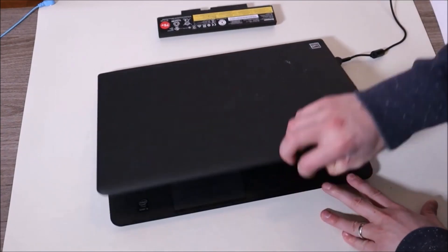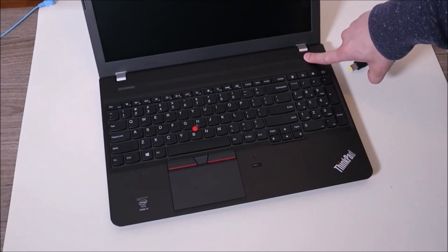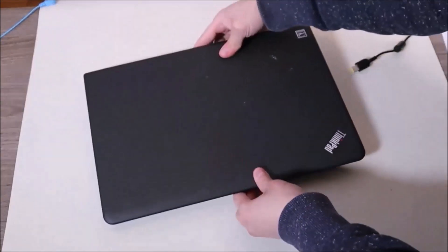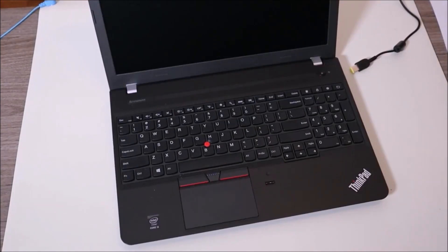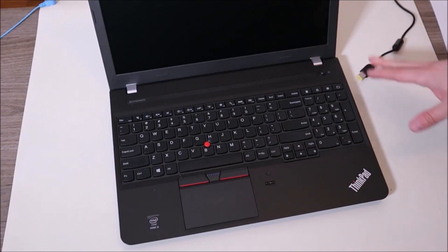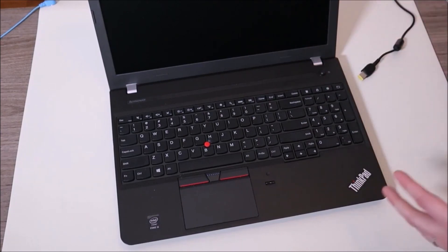If that doesn't help your computer turn on, unplug your charger, press and hold the power button for another minute, and now put your battery back in but leave the charger out — kind of swap them and try the other one. Try turning your computer on. If your computer turns on, you've identified your power adapter as most likely faulty and I would replace it at this point — your battery is probably good. If these things are not helping, try doing them a couple times. Try holding the power button for one minute repeatedly. Try this process a couple times, as some of you may need that to fully drain the power.